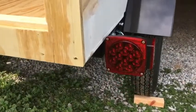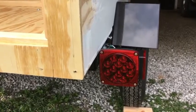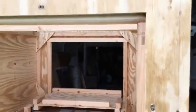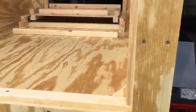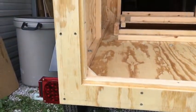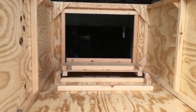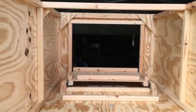The light kit is all LEDs on the trailer, which is nice. I have about a half inch ridge all the way around the openings, both front and back — that extra board not only adds strength but also provides a kind of shelf for the door to fit into so the doors don't get pushed inside. They're super strong, probably way stronger than necessary and a little heavier, but I just don't want any issues on the road. I want this thing to work as planned and not have to be fixing something out on a trip.